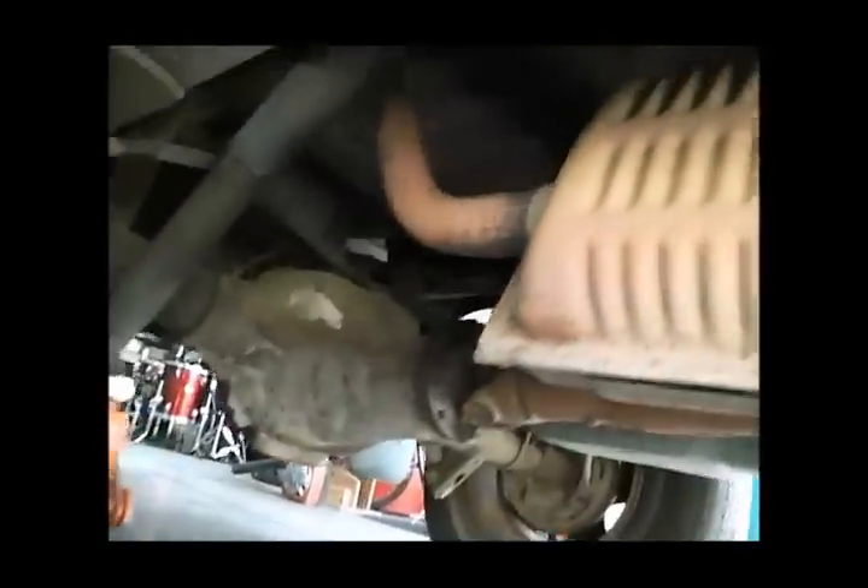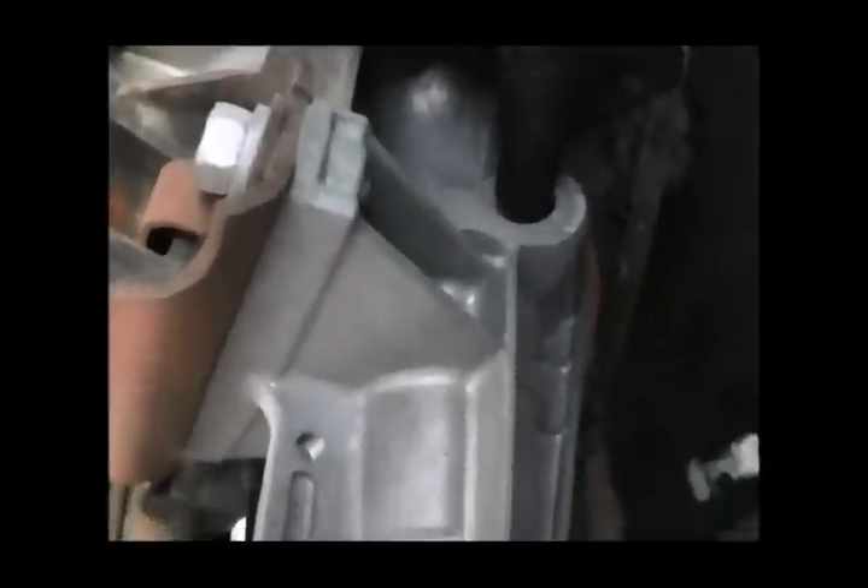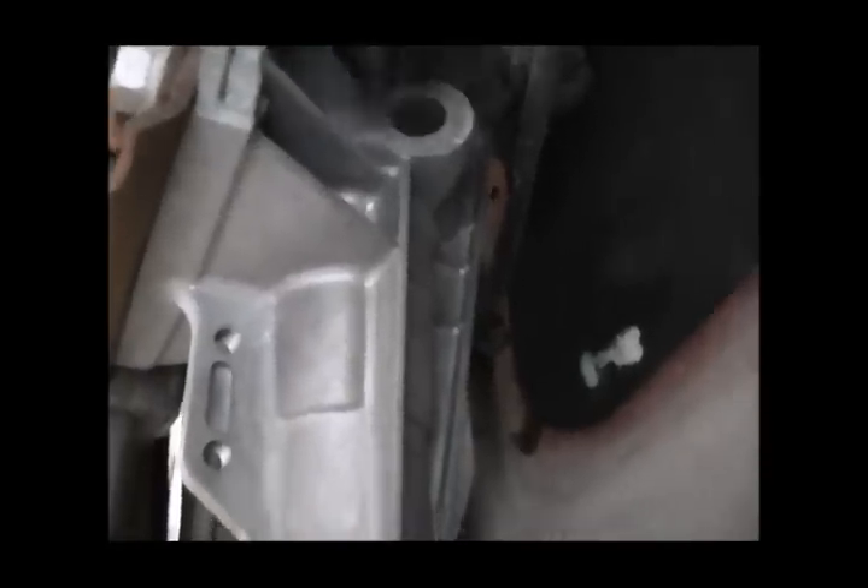It does not have a cable. It is an electronic sensor. There are a couple different types of sensors on this truck. One is back here on top of the differential, and that is actually the ABS sensor which is shared with the vehicle speed sensor for the computer, the ECM. You want to check the transmission first. On my 96 Ford Ranger, that location right there is where the speed sensor is located — or possibly a cable. So there are three options on this. It says 93 to 2000 in my Haynes manual, and all of them are the same, but there are three different locations for the vehicle speed sensor. It doesn't go into detail — it just says if you don't have a cable, then you've got an electronic sensor.